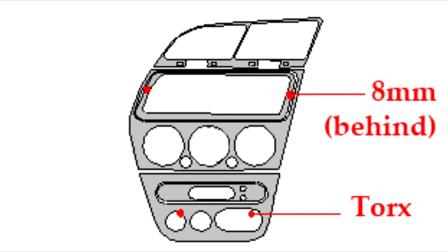Now another note is that the aircon unit, these switches are part of the aircon and not the front fascia, so they will not come out when you prise off the front fascia. And I've just cheated again. I've actually unplugged everything from the backs before getting to it. Once again, this can go down behind the seat.